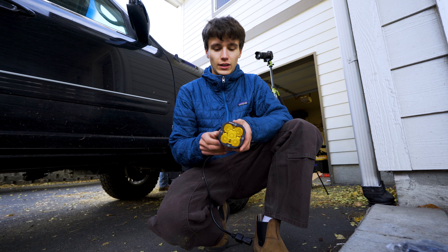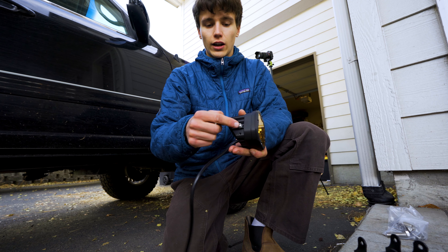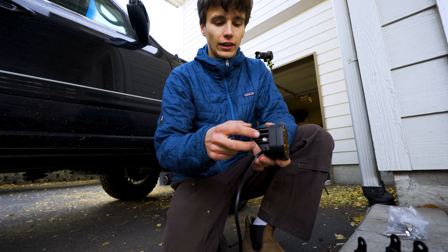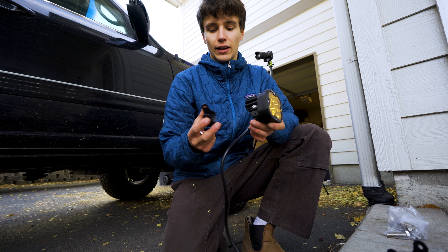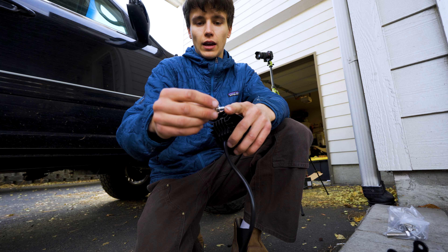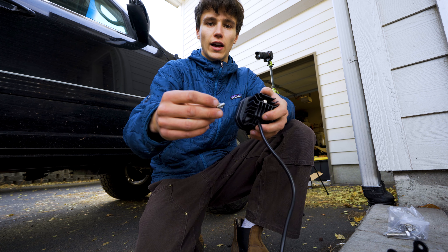The first thing we're going to do is start mounting the mounting brackets to the ditch lights. You can see on the ditch lights there are a couple of washers — the locking washer and an Allen bolt — and we're just going to unscrew those, add in the mounting bracket, and then tighten everything back down. Keep the order of the washers: it's the bolt, then the locking washer in between, then the flat washer on the end. The flat washer is pressed up against the ditch light.